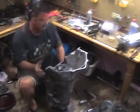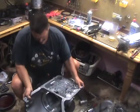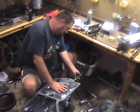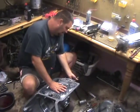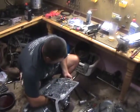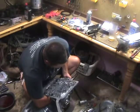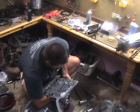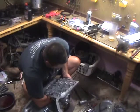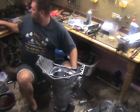As you see here, I'm going to go ahead and start putting in the next pieces, but you've got to put the tail shaft in. Make sure that you lubricate the tail shaft when you put it in. Even though we put new rear bushings in the case, I'm checking the bushing against the shaft itself. You want to make sure that nothing's dragging on it and nothing has any kind of hang-ups or burrs or anything like that. So it's always good just to check it.